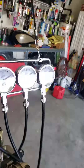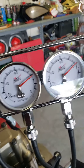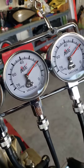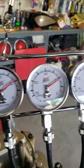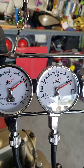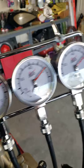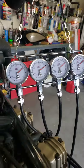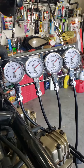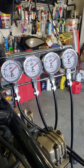Syncing the carbs and they're looking pretty good. Got just about 20 except that number 2 cylinder is a little low — that's the best I could get it. 20 right across the board.